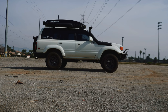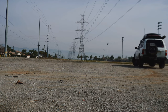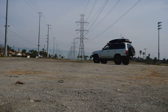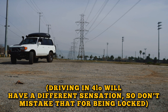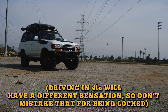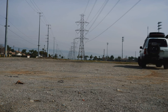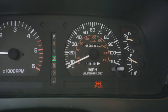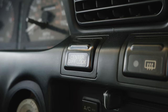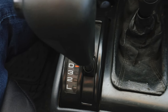The second test is to drive in circles on a dirt or gravel road. I'm not really a fan of this test because it requires knowing the feeling of having your locker engaged, and for those who are new to the truck or have never had their locker working, you won't really know the feeling. The feeling is supposed to be some binding and tightness in the steering wheel while turning, and the dash indicator light should be showing. On mine something is definitely wrong because the center diff lock is not pressed and the transfer case is still in high.